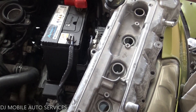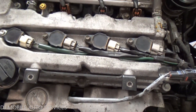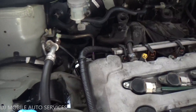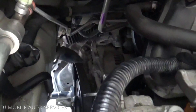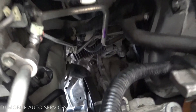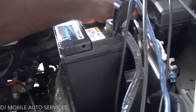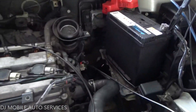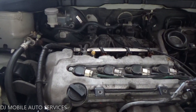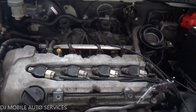The client has to face reality and spend the money — no ifs or buts. The garage has to pay for the time taken to swap the engines and pay me for the diagnosis. A four coil pack engine is not going to work on a two coil pack setup. I attempted to get the ECU pin out but it was more hassle, so I decided to go straight on the signal wires for the crank and cam sensor to set up the scope.